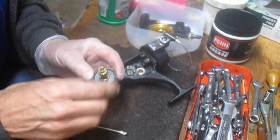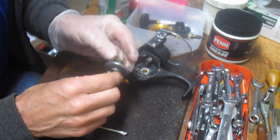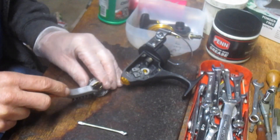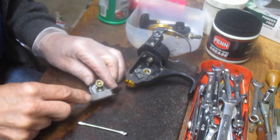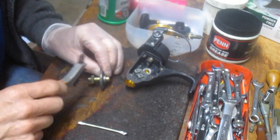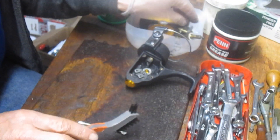You want to check two ways — visibly straight on and then from the side — making sure that all of the teeth are uniform and that there's no scarring or broken teeth. These seem to be all right. Then I'm going to take a little wire brush and clean out the stuff in the channels, because it's quite possible that some sand got lodged in there and that would cause noise as well.